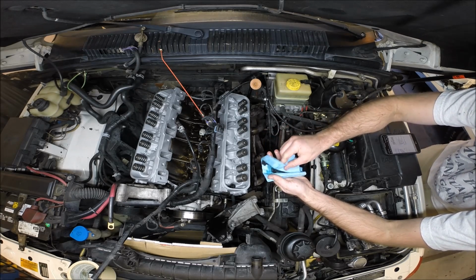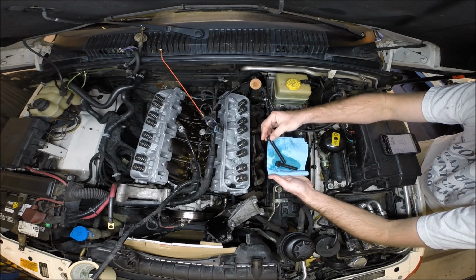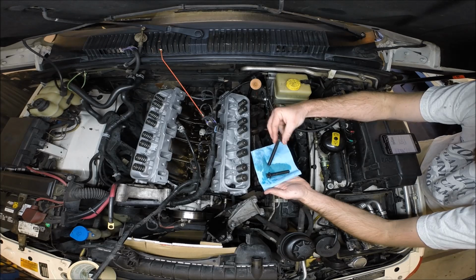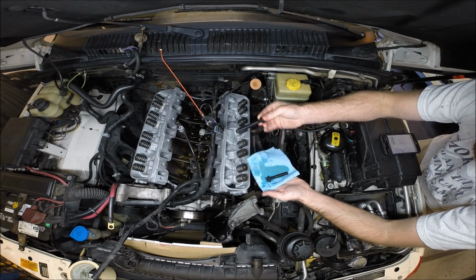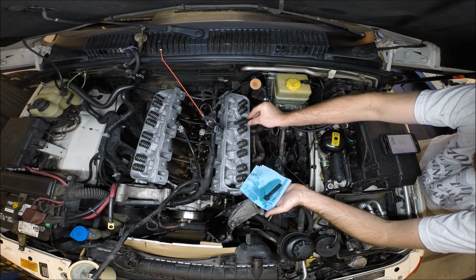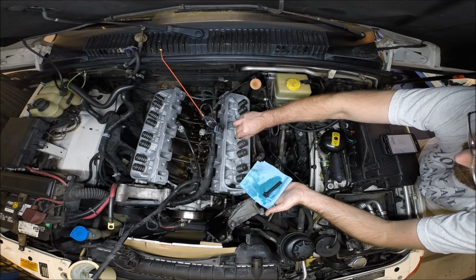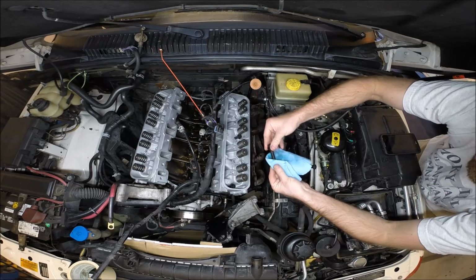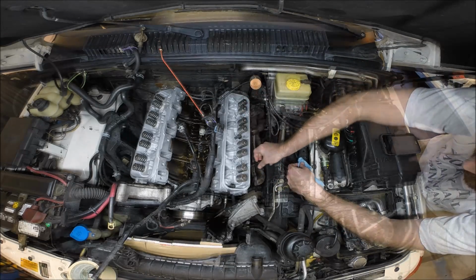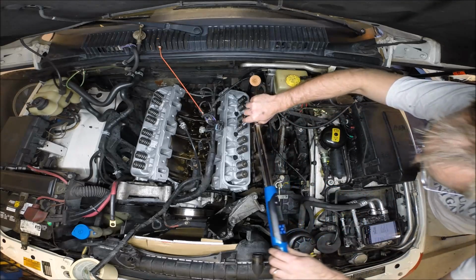And I'm going to put them in. We went to so much effort to clean the head, the gasket, and the block of any oil contamination. We don't want to contaminate it now. We want to put these long bolts in positions 1, 3, and 5, top here, and just give them a couple of turns. There we go. And the 7 short bolts go in all the other positions. Again, the first tightening is to torque spec, and then after that we do angle.